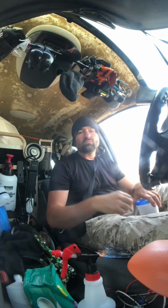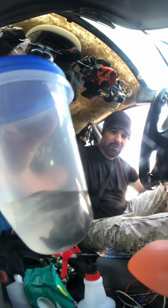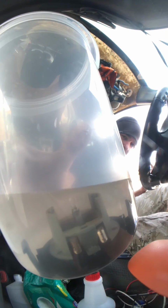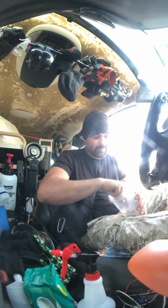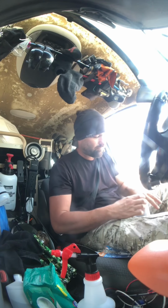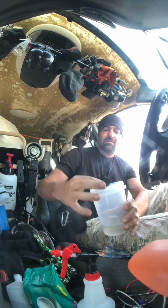And we'll come back. All right, and we're back with this light socket, automobile light socket corrosion removal process with the cleaning vinegar. You can probably already look in there and see that the terminals are looking a lot nicer than they were. I think it's been a couple hours, maybe three. See if I can just let that swirl some of that out of there before I have to start scraping it.